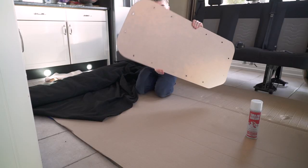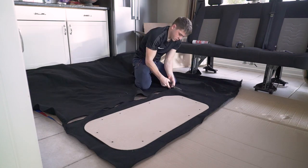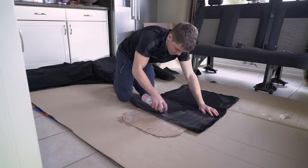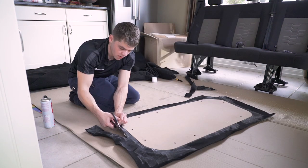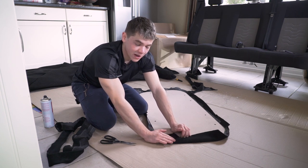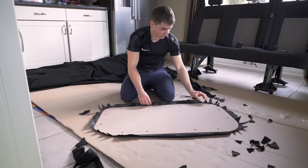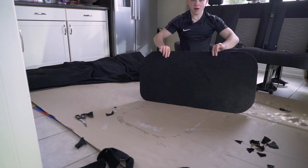Here's my panel - making sure it's the right way around. This is the side I want to carpet, this is the side that's going to be against the van. I'm going to cut a little square a bit bigger than my panel. It's glue time - I'm going to glue this part of the panel and then glue this part of the carpet, stick it down, and then work my way across. That's how sticky it is, it's not going anywhere. The difficulty is because this is a curved panel, taking it round the corner - it's not going to sit flat against the van. I saw one guy had a technique where he would cut small triangles in the carpet, so I'm going to try that. I've cut out all my triangles and I'm just going to work my way around it. One panel complete.